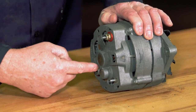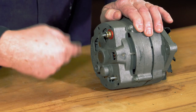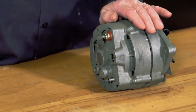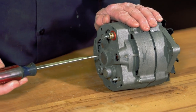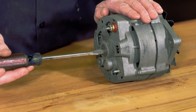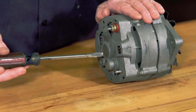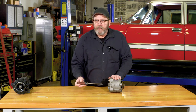The alternator has a rotor that is actually an electromagnet. As soon as that electromagnet is energized and rotating inside the coil of wires, it creates a magnetic pull. With the engine running, just put a screwdriver up against the back of the alternator right in the center, and you should feel a little bit of magnetic pull — that indicates the rotor is actually energized and you're creating power.